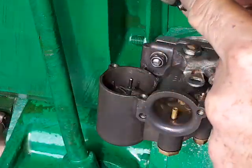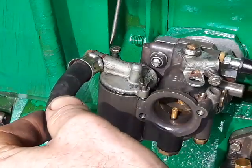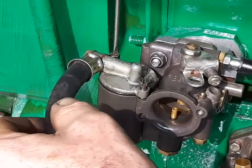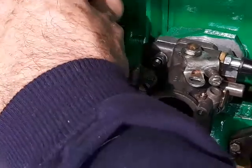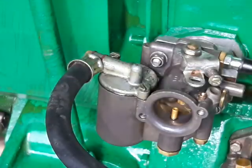I've also put a stretched O-ring around this lip to stop leaks. We've now got this engine running lovely with the manual choke conversion as well. This engine will not only start but will run correctly in tune — basically ready to go out.